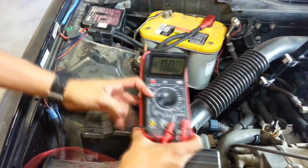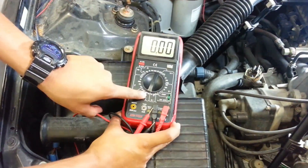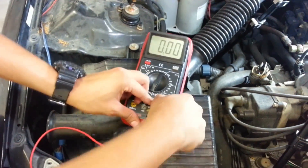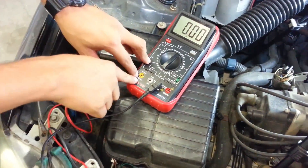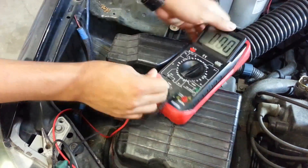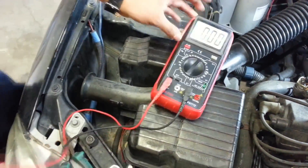What you're going to want to do is test which circuit in your car is draining the most current. In order to do that, put your multimeter on the 20 amp mode. Once you have it set there, you're going to pull the red plug out and put it on the yellow one, which is the unfused 20 amp port. You want to use the 20 amp setting to avoid burning the fuse in case there's more current drawn than you expect, which is likely if you have a short circuit.